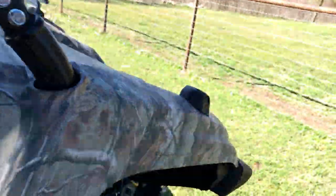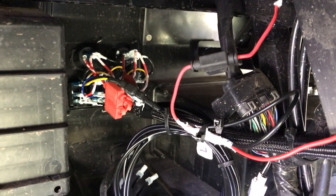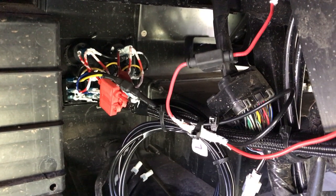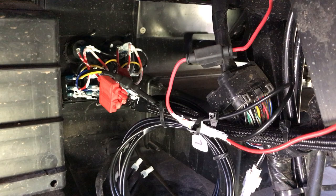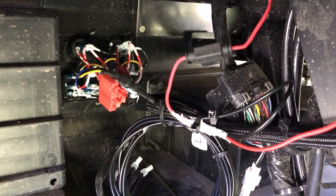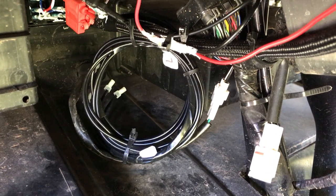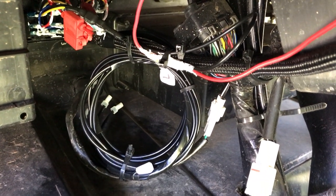Let's show you all how it comes out. The wiring part of it — I've wired everything up there together. You take your two grounds, run them together, run one ground all the way to the battery. You have a hot lead that goes to the battery, and then you have a hot lead that goes to the ignition switch. All the coil wires you see there is the hot off each switch that's going to go to my light, radio, or whatever else I plug into it.